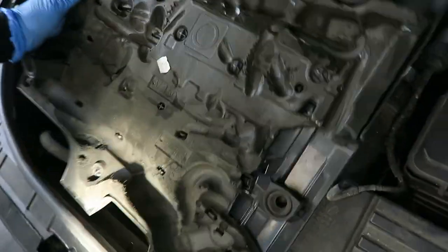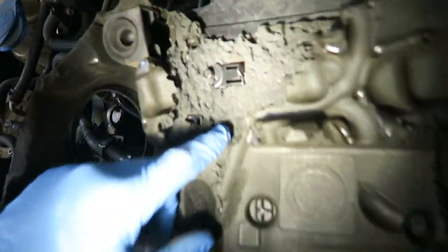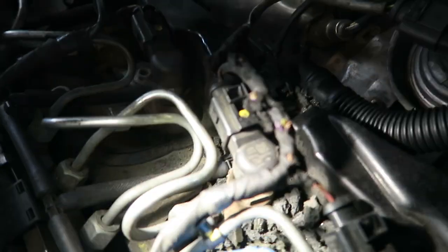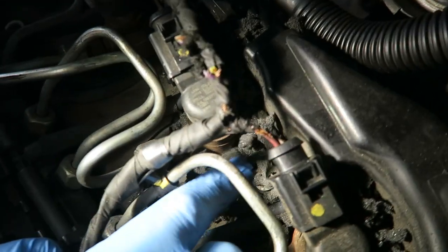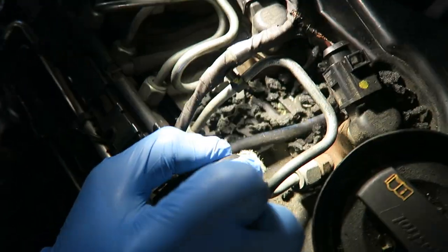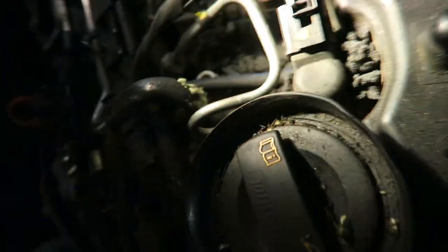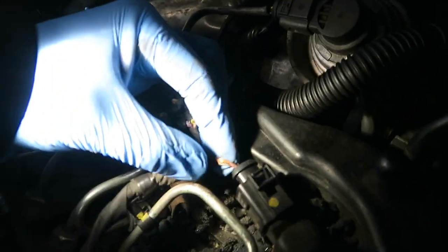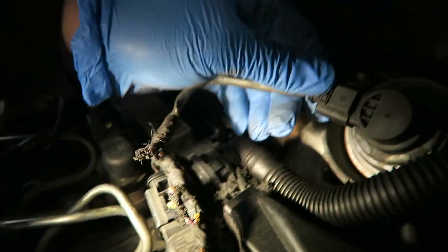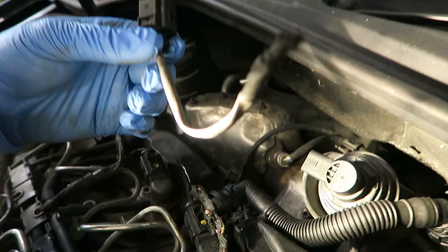Oh dear. As you can see, looks like something's been trying to make its house. Nice. Oh yeah, if you look in here, there's the remnants of the engine cover. Looks like we've had Mr. Mouse in. Oh yep, he's eaten halfway through the diesel pipe, which we can see there. Oh god, here we go, look. You've got the injector wiring loom there, bared right back where he's eating it. Oh, we've got chopped wires here, straight to the turbo actuator. So there is our fault.